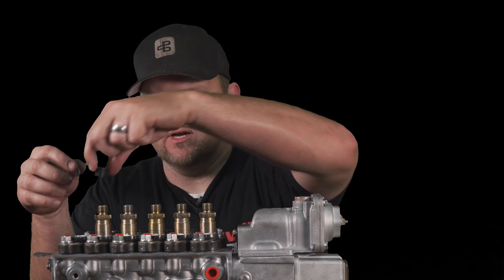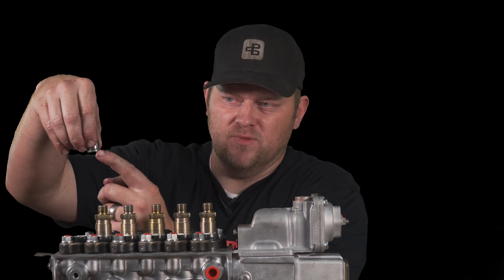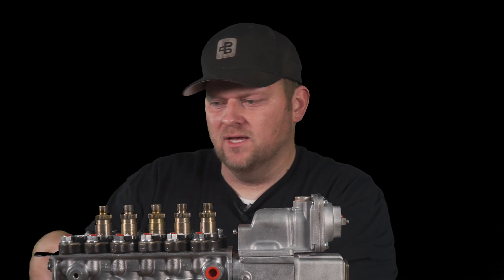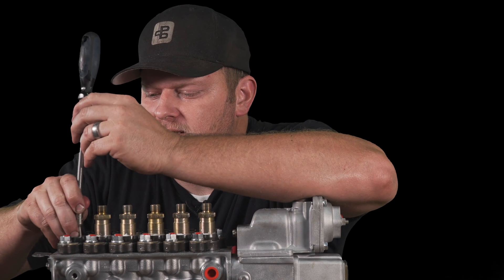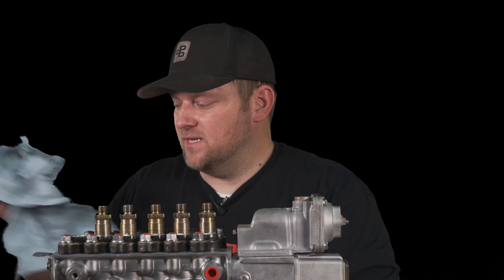The new one goes in the same way. If you have a 180 pump, the delivery valve will look almost like it's inverted. When you put these in, look at the instructions, but the big end goes down on the power-driven delivery valves. We also want to make sure there's not a little O-ring — sometimes there's a little metal sealing ring under here. We don't want to reuse that. If you really want to be careful, you can carefully reach down with your magnet and check. But you don't want to touch the top of that plunger and mar it up — those things are lapped to millionths of an inch, which means if you drop a magnet hard on it, you can mess it up.